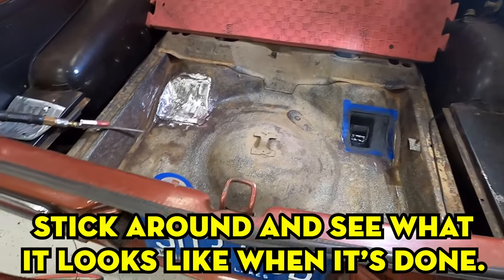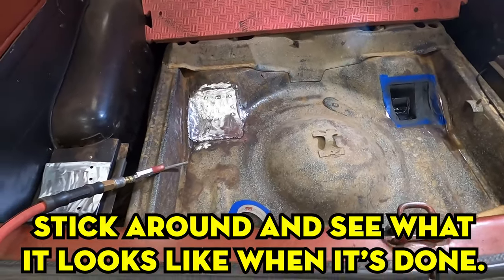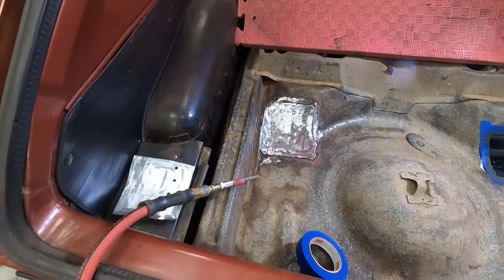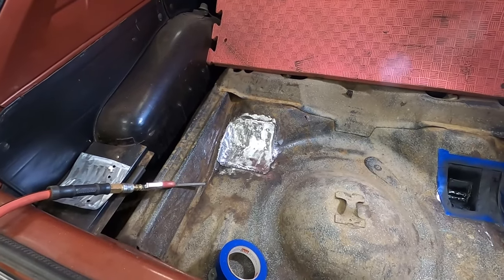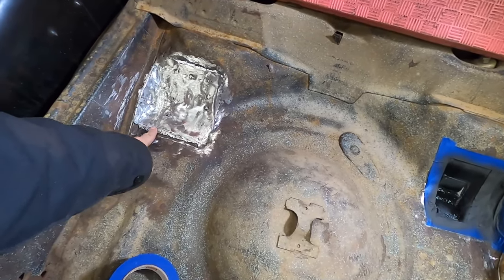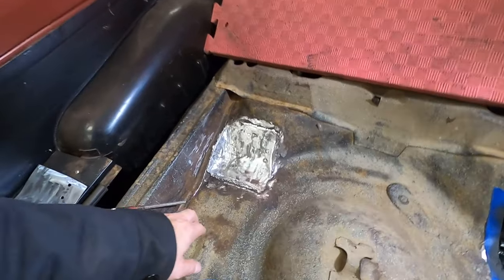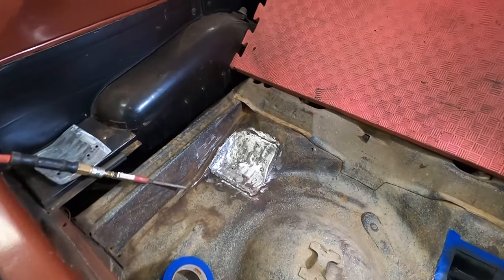This is just kind of a get it fixed up a little bit type of thing while we got the gas tank off, and that's kind of what we were trying to do. So it ends up being a lot more work than what we anticipated it to be. But this one, because of the way we had to cut it in brackets and shapes and bends, it ended up being a lap weld. Inside of the trunk down here, there's a dip down right here where it mounts out, so it was very difficult to get the weld built up to that. But we was able to drill holes through and plug weld to the gas tank brace, so that was great. And we was able to get this bend in here up here, so the side is nice, and that is taken care of.